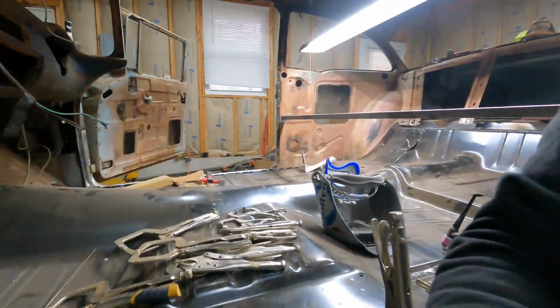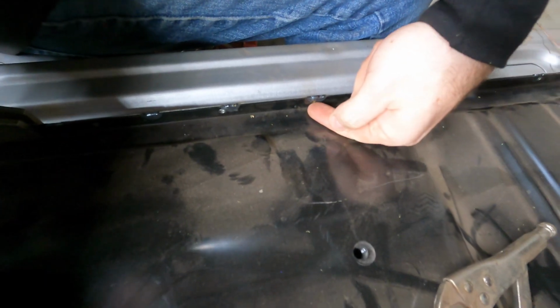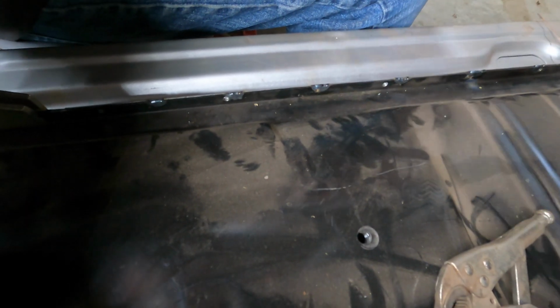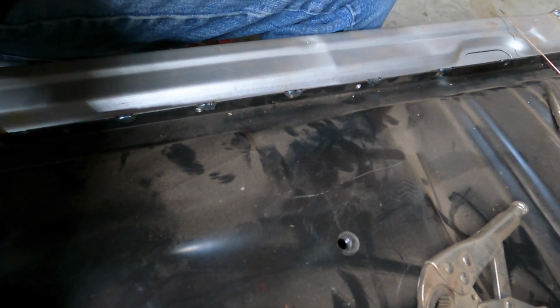Now, you can do the exact same things with the wire feed weld, and if filling in these holes with a wire welder, what I would do is when starting the weld, I would point the filler and the torch at the bottom of the hole, and then make a circle around to fill up the hole. I'd actually make it larger than the size of the hole as well than what this punch does.